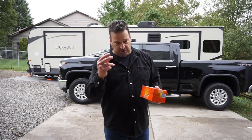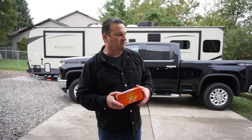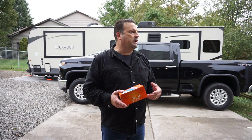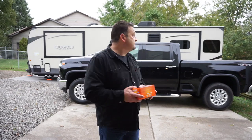Also, don't forget to prop your refrigerator door and your freezer door open. Rockwood gives you two little pieces that go on the end of the freezer and refrigerator door — they're little flat pieces that prevent it from locking and let an air gap in there. Turn the refrigerator off and let it defrost naturally so you don't get mold and mildew. We're still plugged in late October, with the thermostat running off gas at about 50 degrees inside. When it starts to get colder, I'll probably unplug it and just let it go for the winter.